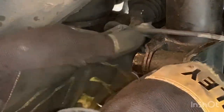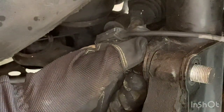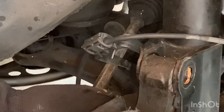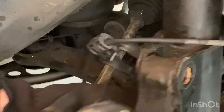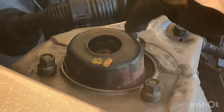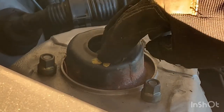Now it's just a matter of getting these bolts out — you just wiggle it a little bit. Then go up top on the engine to the top side of the strut where you'll see three nuts. Once these three nuts are removed, the strut is going to fall right down, so you need to grab it at the bottom.